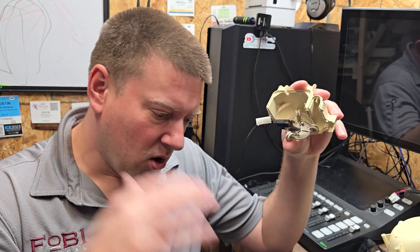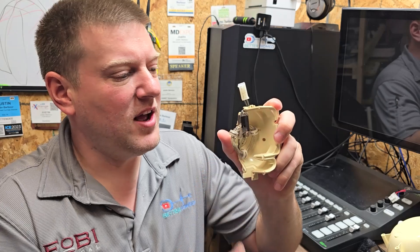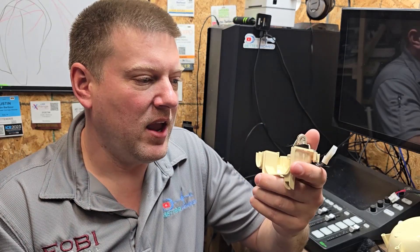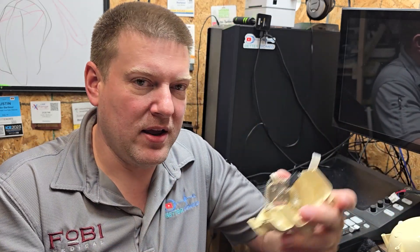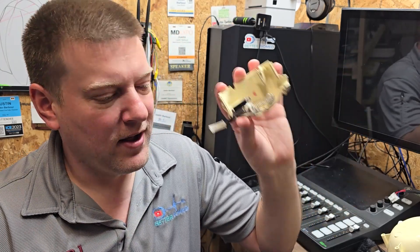This unit here is defective based on this temperature-limiting reed switch. The reed switch disconnects - it just never reconnected. They do have a life cycle, a certain amount of cycles. Apparently probing it also changed the ohms values - it was open, but as it cooled off, as I transported it and probed the back of it with my meter leads, it got to 200 and some ohms. There's no way it's going to heat up at 200-plus ohms. This is the part that's bad. That is the Medela milk warmer - defective but a good teardown. Hope you guys enjoy it, thanks for watching!